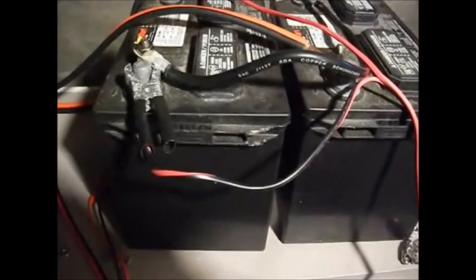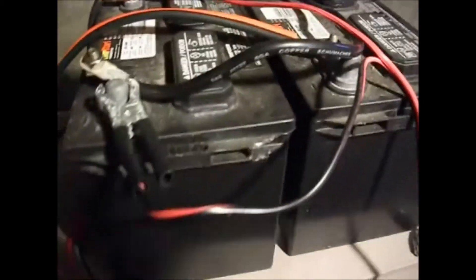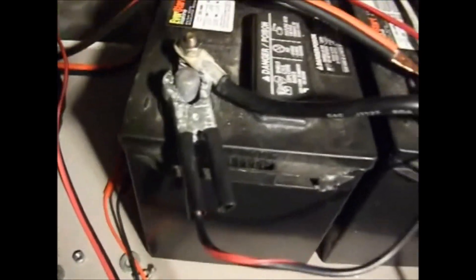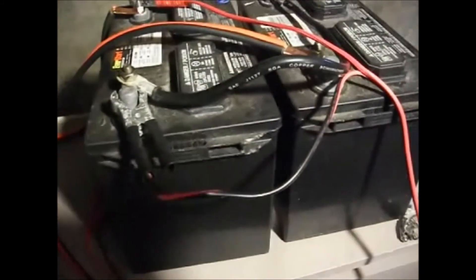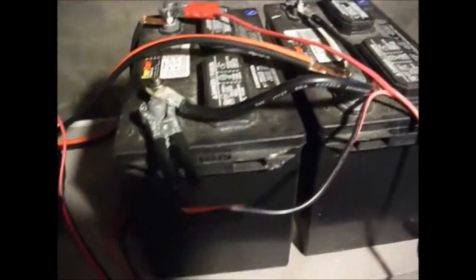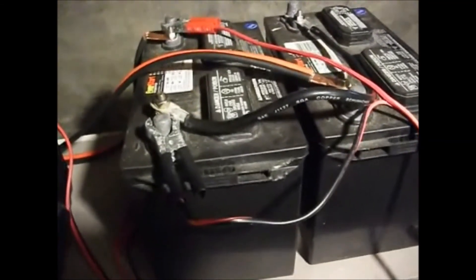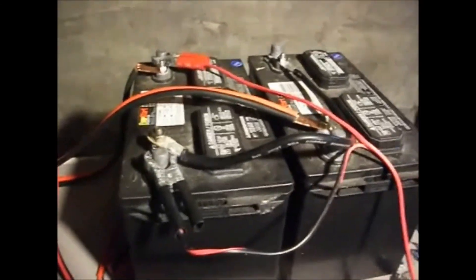I'm going to combine those two videos and make one out of all of it. Alright, have a great one YouTubers. I just noticed — just so you guys know — I got gauge six there, allowing my battery to make it 24 volts. And there's a hole there — it melted down from the heat. I didn't realize it because I was painting the engine, but it looks like it's building up too much heat. So I'm probably going to have to gauge it down to maybe gauge one — the bigger it is, the less heat it's going to produce. There is too much heat going through this line. It melted down one of my poles, so I'm going to have to review this and reconfigure it. Just to show you guys what's going on. Bye bye.